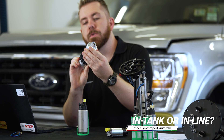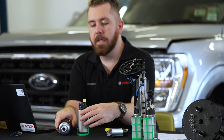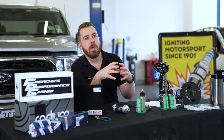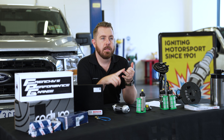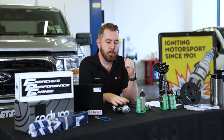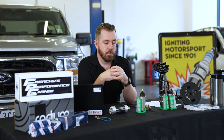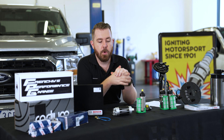An external fuel pump like this was once the default choice for anyone building a high performance vehicle. More recently we've seen a surge in popularity of high performance in-tank pumps such as the Bosch BR540. Once you put a pump inside the tank, a lot of the componentry and noise associated with running that pump are contained inside the tank — less noise, less fumes, and overall a more street-friendly and comfortable cabin. There's still a lot of popularity for inline pumps, particularly if you've converted a car from carburettor to EFI, if it had an inline pump fitted from factory, or if your tank is small and you can't run three or four in-tank pumps — in those cases you'll still prefer an inline pump.